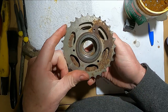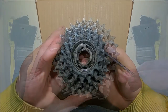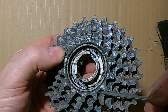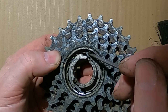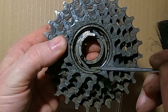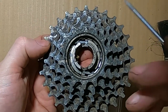This is some footage of a five-speed freewheel so you can see more clearly how the pawls and ratchet work. As it turns you can see that pawl is locked into that little slot - interestingly this one's in the middle, so you're only ever transferring power through one pawl at a time. Then when it turns a bit more you freewheel for a bit, and it locks in on the other side. So when you're freewheeling it's like that, and when you pedal it locks in.